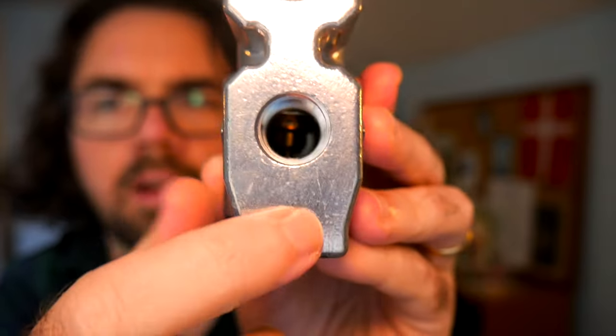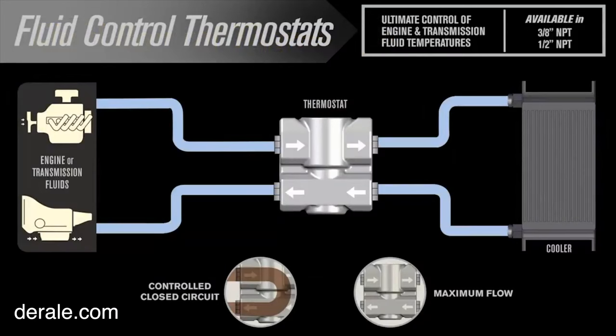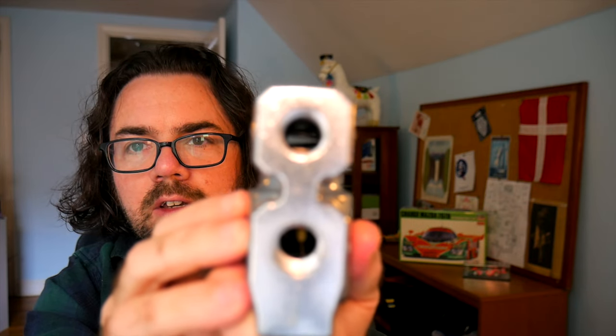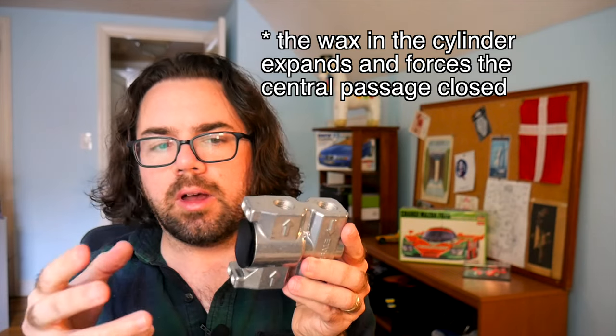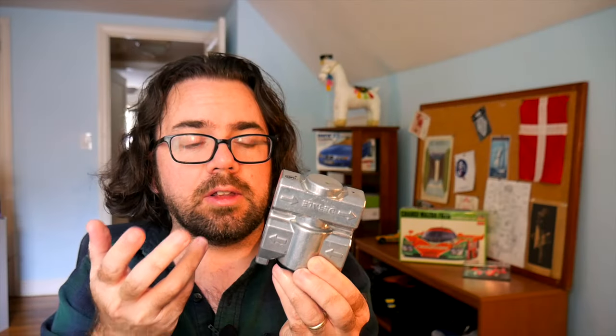I'll show you the inlet and outlet. You can see through it — it's only impeded by a spring, and fluid can also flow through the bottom. It's mostly unimpeded. There's a chamber that passes through here. This thermostat is cold right now, meaning that chamber is open, so fluid can flow from your transmission all the way through to the cooler and back. But when this central part is open, the fluid wants to take the path of least resistance, so the vast majority of that transmission fluid is going to go through the chamber and right back to the transmission. However, there is a waxy substance on the bottom. Once it warms up to 180 degrees, the spring will close the central section, forcing the fluid to actually go through the cooler and back to the transmission. That's basically the same theory as how your mechanical engine thermostat works.